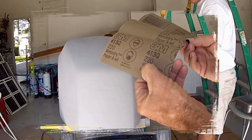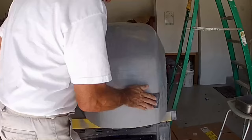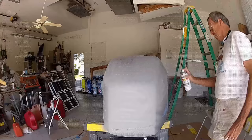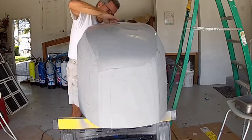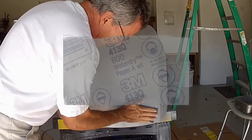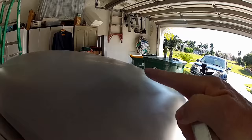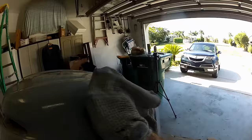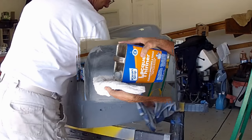The wet sanding starts out with 220 grit wet sanding paper and is followed up with 600 grit wet sanding paper. We will finish with a fine nap steel wool. Clean with lacquer thinner as we did earlier and apply the second coat of primer. This last sanding of the primer coat needs to be a little more particular — this is the last step to correct any errors prior to putting the color coat on. So we start with 220 grit lightly and follow up mostly with the 600 grit, looking for imperfections in the paint using critical light and making sure those are all smoothed out — polished virtually smooth. We know we're finished with this step when the surfaces look perfectly smooth and shiny when wet in critical light.